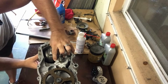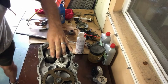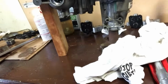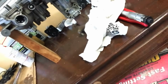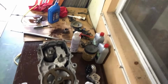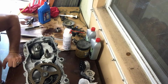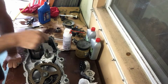And then the next thing to do is to install the shaft that goes in there. I'll show you a little something here. Hopefully you can see it. Alright, well, not great. So you can see the little pistons in there. Try to get those as even as possible, showing evenly on all pistons, to be able to get that shaft in. If it's way off, then your shaft isn't going to go in, so try to line that up and get those pistons showing fairly evenly. That lets you know that you've got your holes lined up through this piece in the center section.